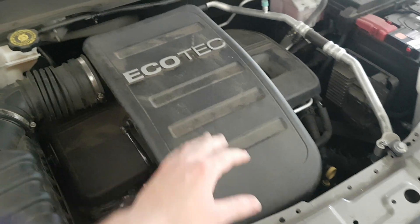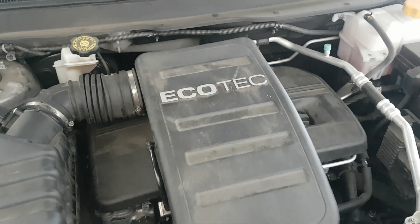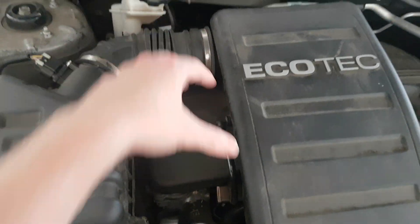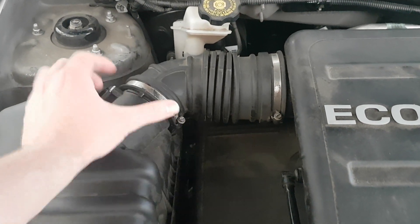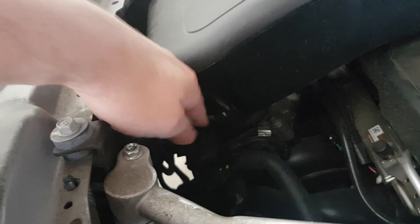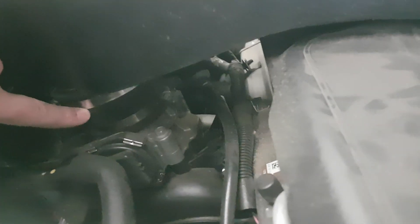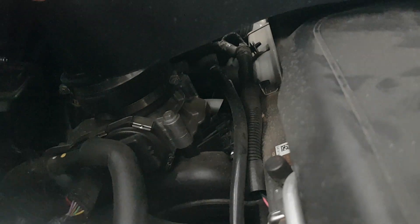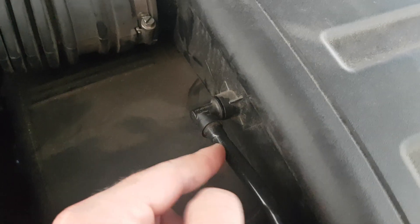What we've got to do is get this part off the top of the motor. This is the air intake - it goes into the engine. We've got to take this off, this cover off, and this cover off to get to the top of the engine. We need to take this hose clamp off - one screw, loosen that so you can just pop that off. Down under here there's another hose clamp with a screw - just loosen that one and then this part will just slide up.